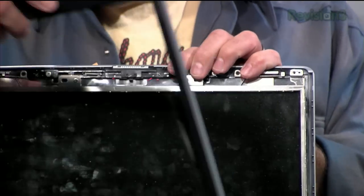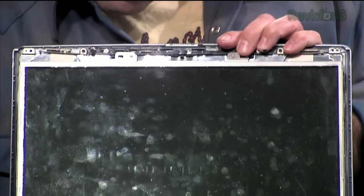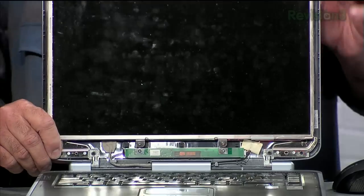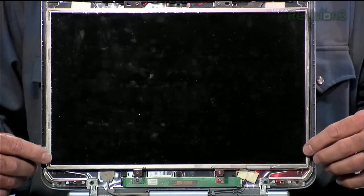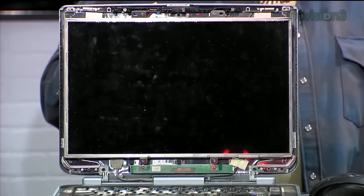They're going to guess their way through it at $75 or $100 an hour. Slightly disturbing. Yeah, so I get that out, and there's some glue. Once you've got that, then there's more screws to get the panel out. And then there's this, and this is actually an easy one, right? Because I can actually take the bezel off and get to the hinges and undo the panel, the CFL controller. There's a couple ribbon connectors in there.